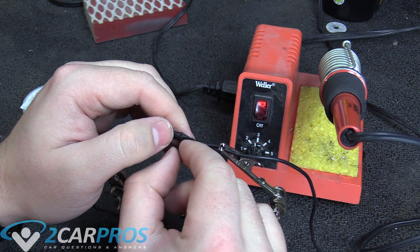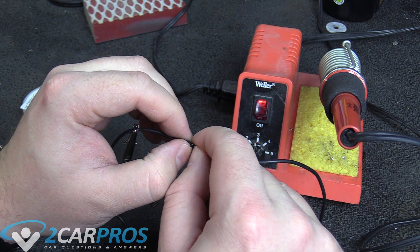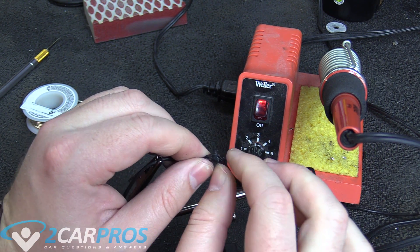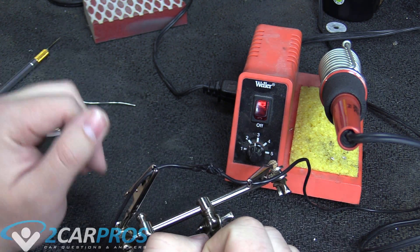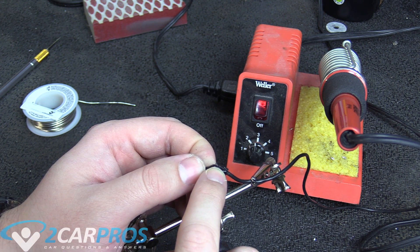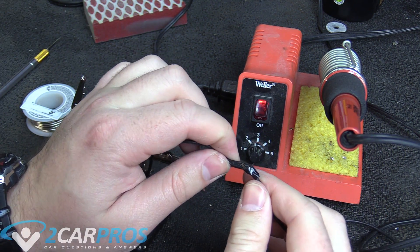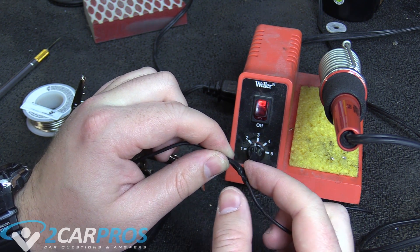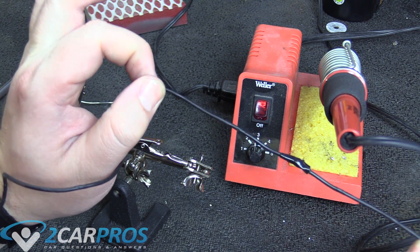The electrical tape application itself is fine and acceptable, but with this way of soldering, I can feel it's already starting to poke through the insulator a little bit. You've got to imagine a little bit of time has passed and there's wear and tear — no insulator is going to stand up to metal poking through it. Even rubbing my thumb just a little bit over this electrical tape a few times shows why this way of soldering doesn't work so great. Because that little piece of metal, imagine it in your car's wiring harness against a form of metal, which is everywhere in a car — it touches, it grounds out, creates a short, and causes all kinds of problems, completely negating the fix entirely.